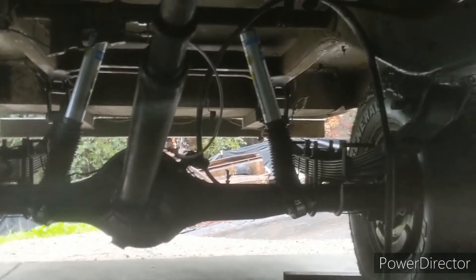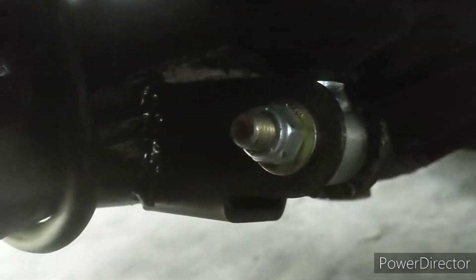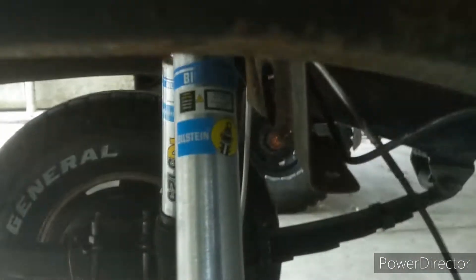The double cardan will add length and possibly fix any small vibration issue from the offset diff — it's not that offset, but we're going to do it right the first time. Rear shock mounts are on. Since the axle is pretty much perfectly centered, it was just a minor adjustment to get the shocks to bolt to the top factory tower — I really wanted to keep it simple. I ran the All Pro extra-long shock mounts — I think they're for the front IFS eliminator — and they got me right in line with the top mount, angles perfectly, bolts right in, no binding.